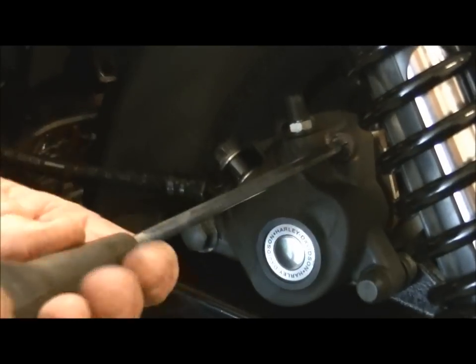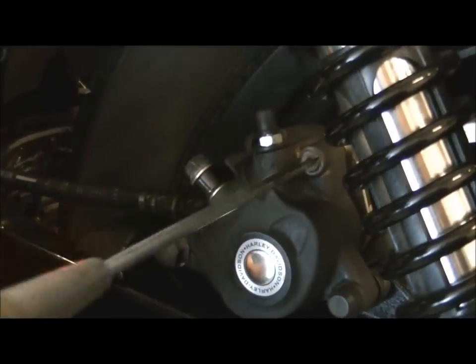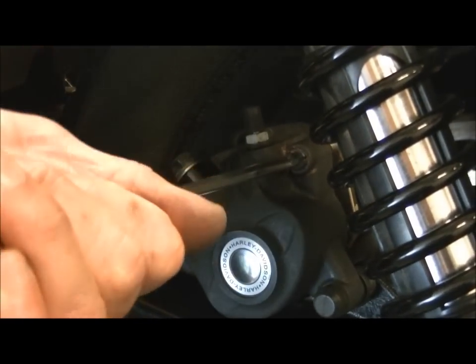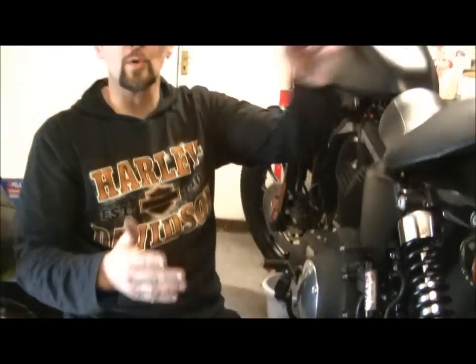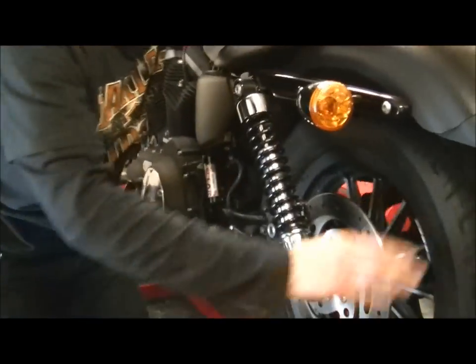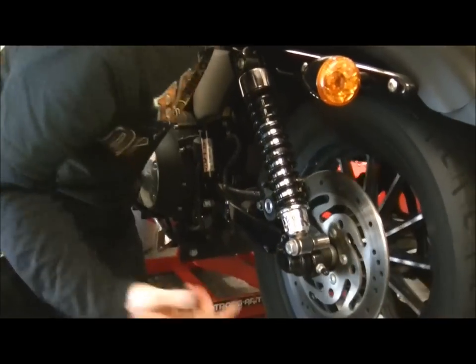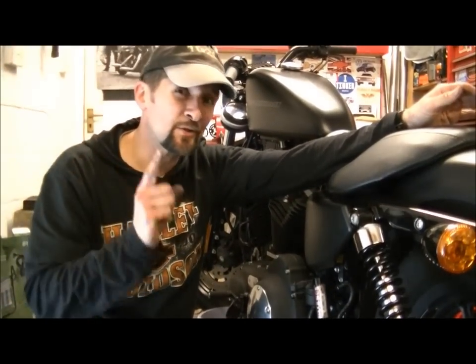That's it. And if you just screw it in and out a few times, you'll spread that grease all around it. And when that goes in, feel where it seats there and just give it a little nip. That's it. Don't overdo it. And there we are. So like all these things, once that lot's all done up and back together, it's now spinning because the pads are backed off. So you know what happens, come to your first bend, we said this before, you've got to hit the brakes and nothing's there, so make sure you pump them out.